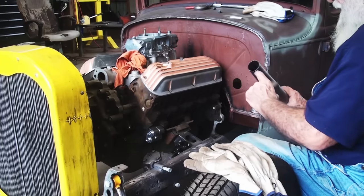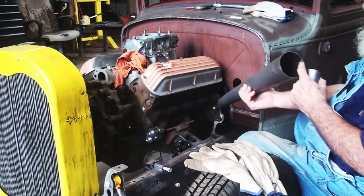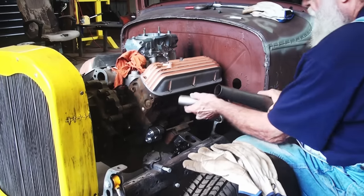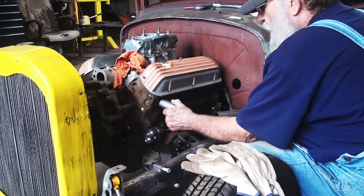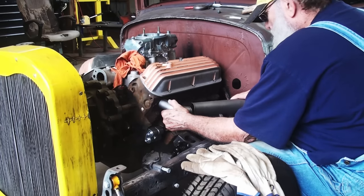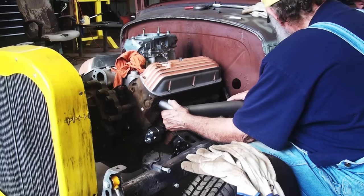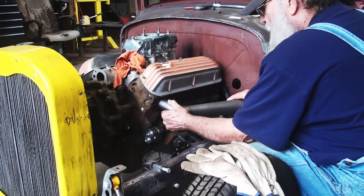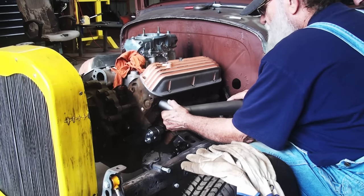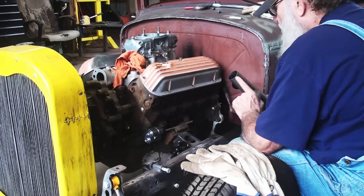And this has got a seam inside of it all the way down. Probably see it right there. Anyway, we'll make sure that's seam down. So I'm gonna put this on where it fits square against that head. And this is gonna go in till I get the right distance, same angle as the cowl, about 1.5 inches. So, need to tack it right there. But before I do, I gotta clean all this up. So when I do weld it, it'll already be cleaned up.